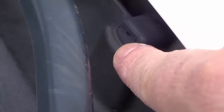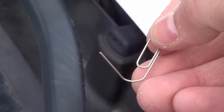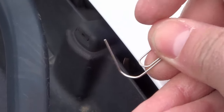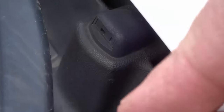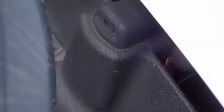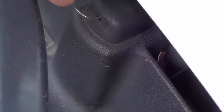So now that you see there's that one little hole over there, what you want to do is get a paper clip — you can see where I have a paper clip. I choose to use a paper clip as opposed to a sewing needle or anything, because this isn't nearly as sharp as a sewing needle. What you want to do is take your paper clip and just press it lightly into that hole that is guiding the windshield washer fluid. I'm just going to open it up just a little bit more, inserting it in the hole and just sort of moving it around just a little bit.